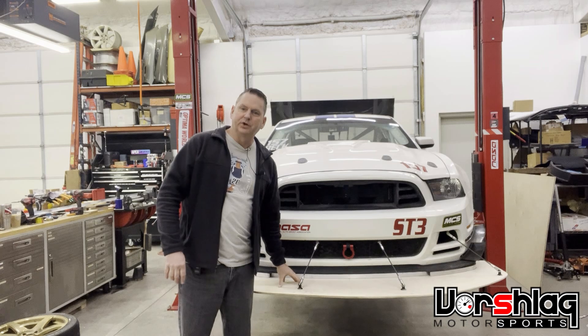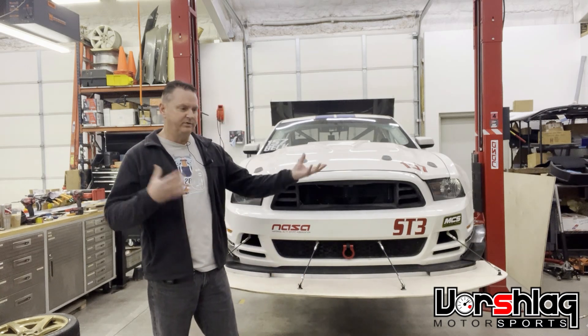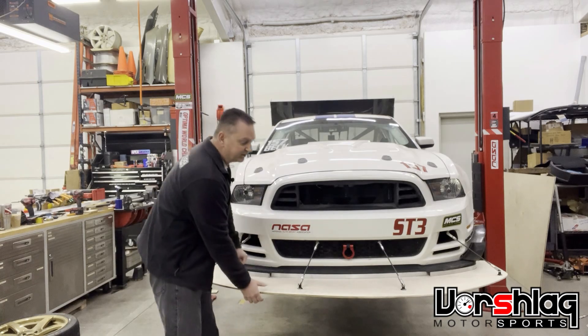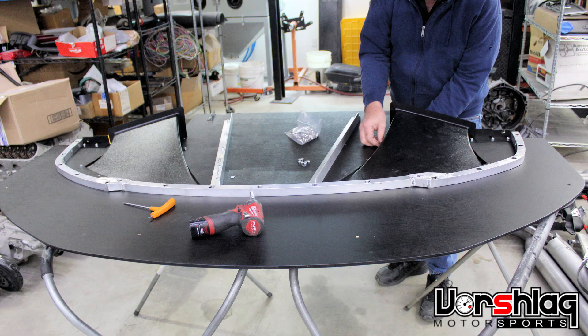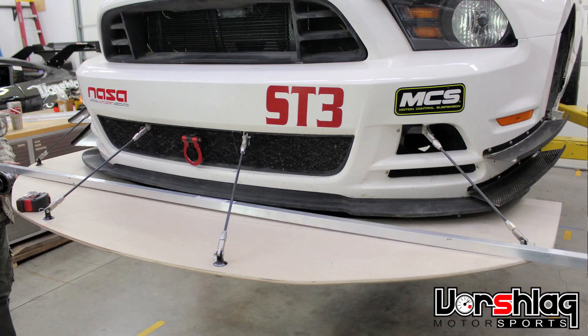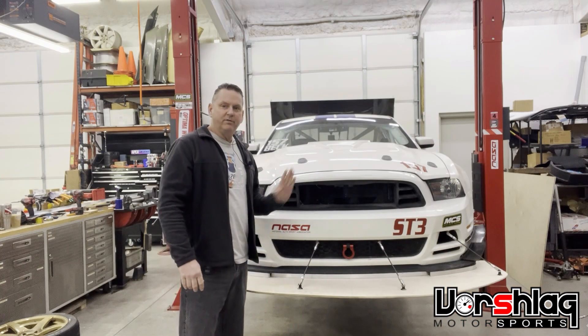Adding stiffness is the tricky part, and we have a lot of ways of doing that. There are several engineers here with a lot of racing experience, but sometimes it comes down to feel. We go out and see if we can flex the splitter plane and see where it's weak. We added a lot of side-to-side structure with a piece of one-by-one aluminum architectural tubing. We bought it at a hardware store, and that helps more than you'd think.